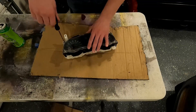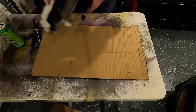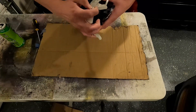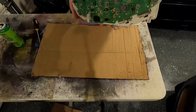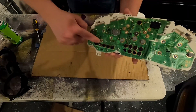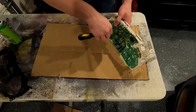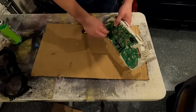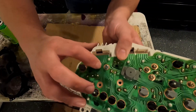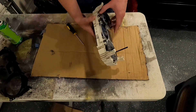We're going to take this face off, then get this black plate off. Now remove these three screws on the back right here. This will drop the tach off the front, so support it and get ready for it to fall. Sometimes you'll get the PCB lifting on the screws — don't let it lift too far, just push down on the PCB and that'll release it from the washer. Now the tach is out — that's all we need from here.